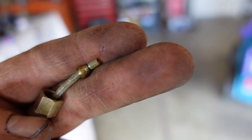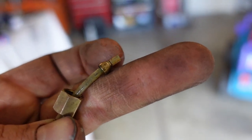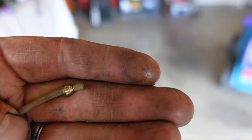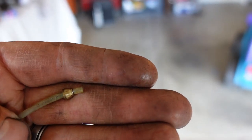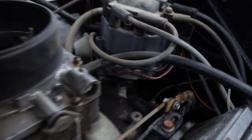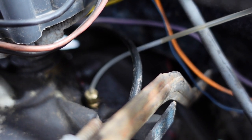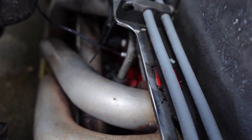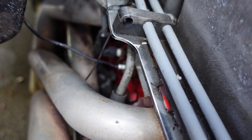So my capillary tubing for the oil pressure — here's that little cone thing, it's called a ferrule. There's another fitting that goes into the block that is the reverse cone, and that just wedges in there and compresses against that tubing, and that nut squeezes down on the ferrule, just clamps down on the tubing, to give you a nice seal. So I got that all hooked up. You can see the new tubing down there. Got a new probe in. It's all wired up.